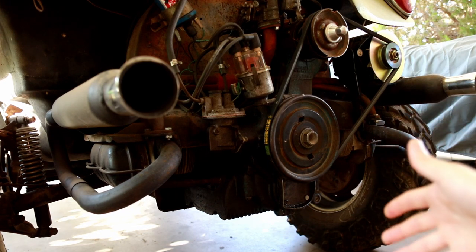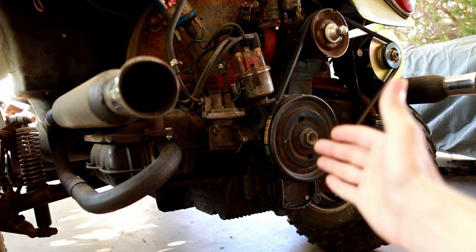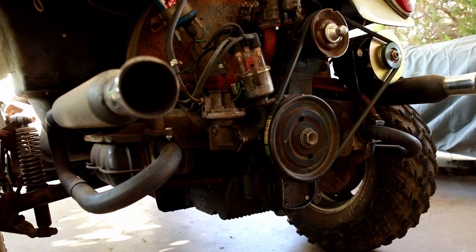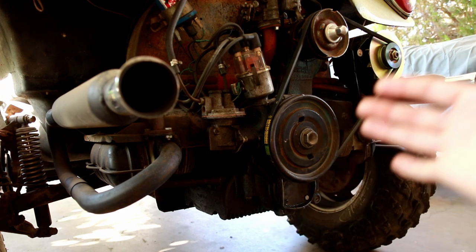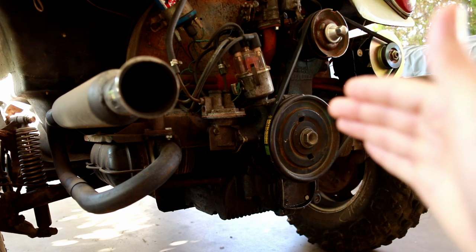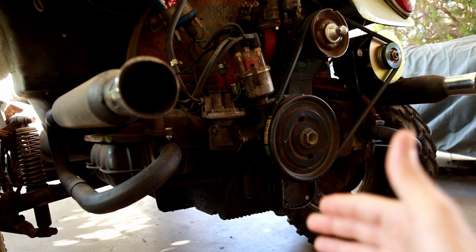While we're talking about putting new cylinders on and all the benefits that it afforded for this thing, I actually had to go do my yearly emissions testing, and I went ahead and did emissions testing with this 36-horse engine that I built from scrap parts, and it passed. I couldn't believe it. I honestly thought it would probably fail because I had the carburetor restrictor and old parts. The valve guides are a little bit leaky too, but it still managed to get well under the limits for hydrocarbons and probably about half the maximum on the carbon monoxide levels. So really a pretty wide margin of safety on that emissions testing.